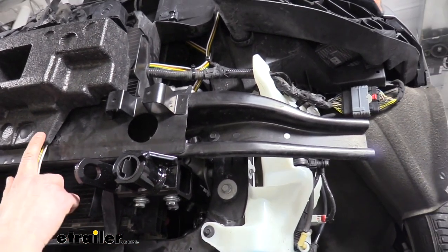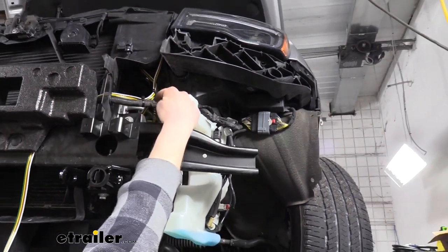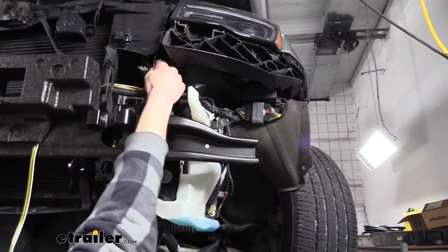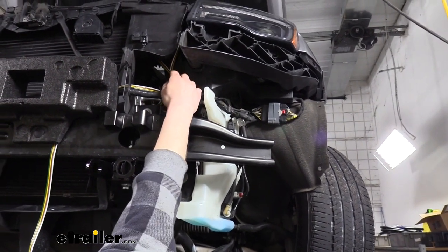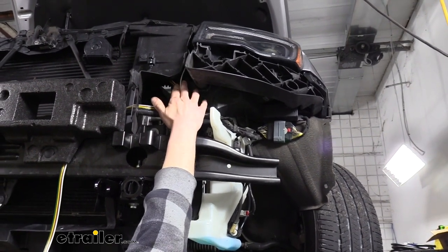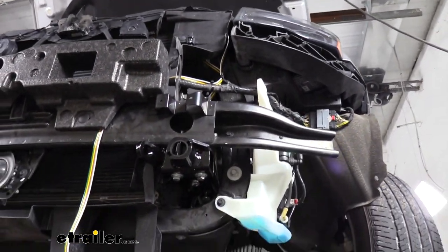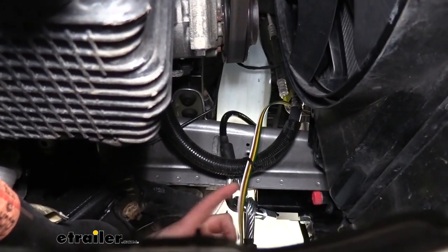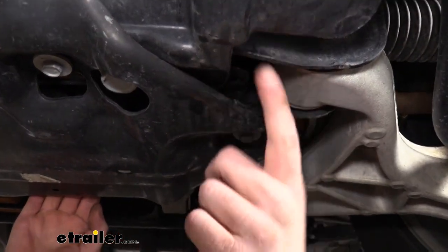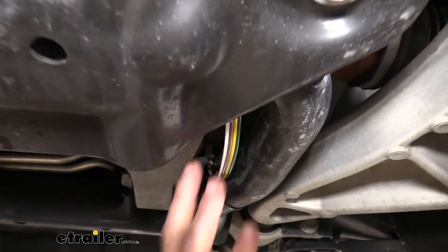The routing path we took: we went behind the foam here up to where you see this harness, zip tied it there, and then we go over following the harness. I did leave a small loop here for customer access because they're not installing a braking system at this time, but in the event they want to install one in the future they'll need to access the diode wiring to tap into it, so here they have an easy access point. From there we go down — it's actually easier to see from the under shield through the access port where we zip tied it to the hose and then just go along the bottom of the panel, following along the side of the subframe and zip tying it along the way to keep it away from anything moving like our steering, suspension, or engine components.